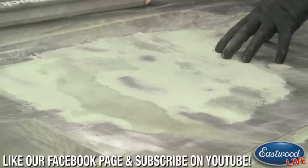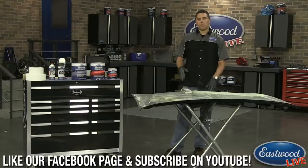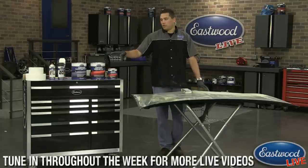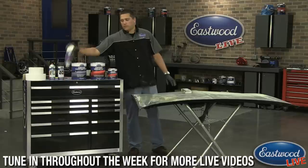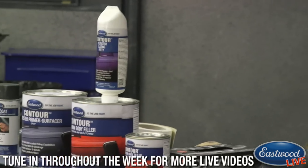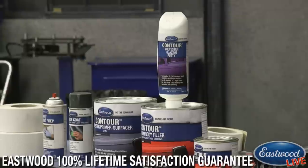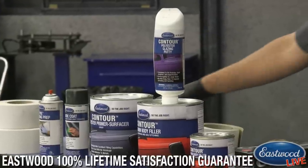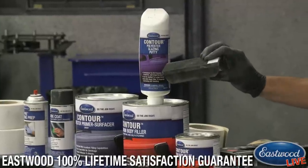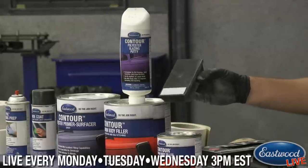And then one of my other favorite uses is door dings. If you're just dealing with this tiny little ding, there's no point in getting out a body filler that's a little bit harder to mix, where you can put this directly over top of a sanded automotive finish that's already on there. If you're just trying to do a spot repair of a small door ding, I just put on the small sanding block right here. I put on some 120 grit, generally speaking. You can tell it's a really small block. It's perfect for blocking around that door ding, so there's adhesion.